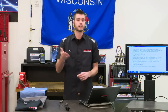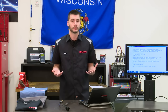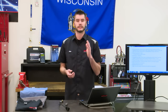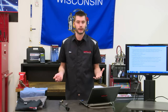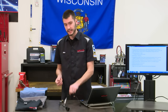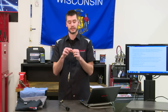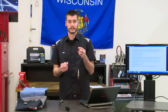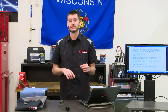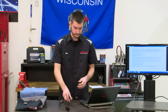So let's say you have a vehicle, they got a bad valve cover gasket, okay, it's leaking a little bit of oil over time, but every 2 months you seem to be putting in a new oxygen sensor, right? The darn thing just keeps failing, it must be the part, right? Well, there's a possibility that that oil is seeping its way into the sensor and getting into the reference air chamber, okay? Remember, these sensors want to be clean and dry to be able to get that air into them, and if you cover the thing in oil, chances are it can seep its way in and create issues.